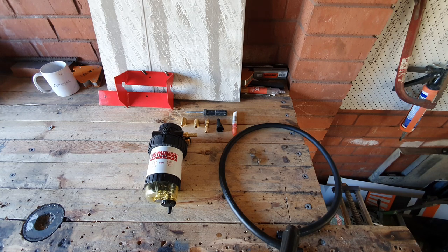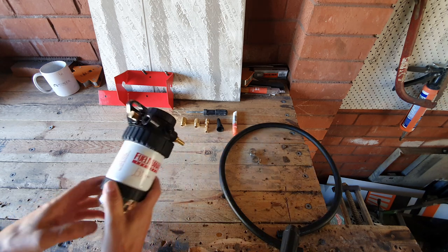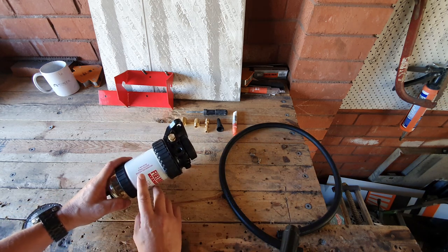At 10 microns you're looking at manifold-level filtration, and then about 5 microns is for petrol and diesel direct injection fuel rail systems. The one I went for is the 5 micron final filter stage.